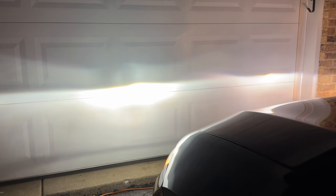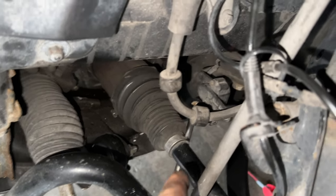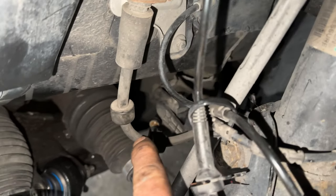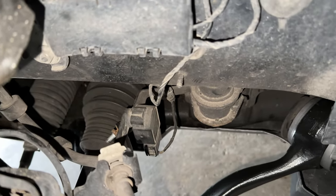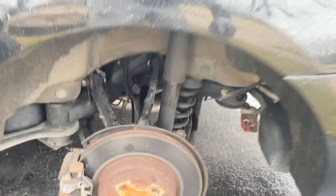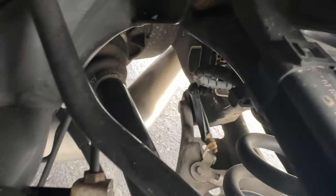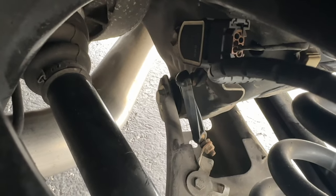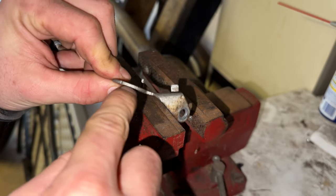Let's start with the first issue as it's fairly easy to check. This BMW E92 has two leveling sensors, one in the front and one in the rear. I started by checking the front and everything looked fine, but when I got to the height sensor in the back, it looked bent out of place — clearly nothing was lining up properly, resulting in the sensor providing false information to the car.